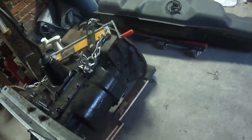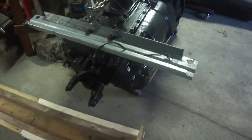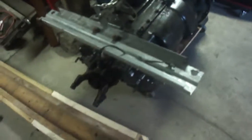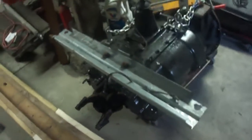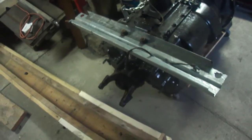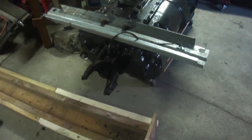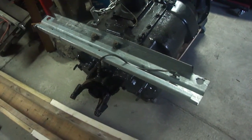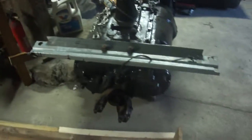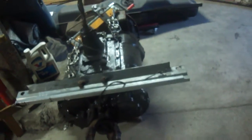For quick identification features: you're looking for a big bell housing, probably SAE 1. Next, look at the rear end — the rear case has an extension that goes past the main case by about a foot to eight inches. If it's air-operated with a high/low feature, it's going to be at least an eight or nine speed. This one is a seven-speed; because of the reverse, you have eight gear positions under the shifter.